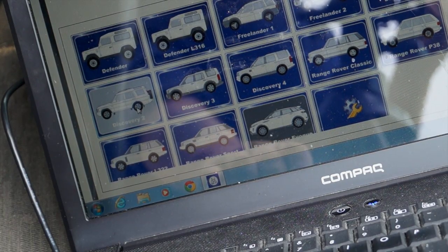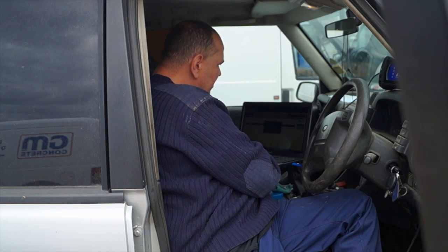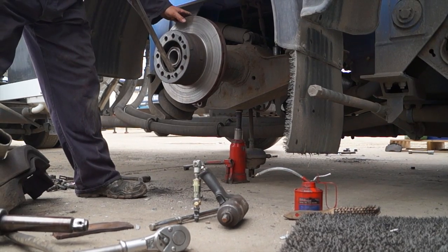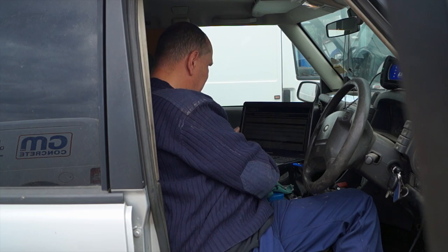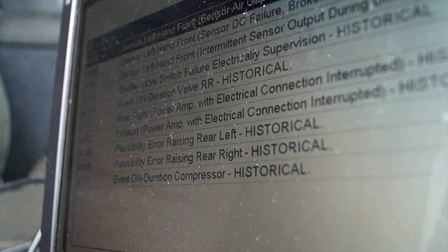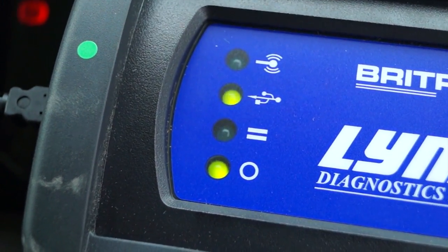Using a laptop with an interface device means you actually have more facilities available. I'm no stranger to ABS faults - part of my job as a Heavy Goods Vehicle Technician is to rectify ABS and EBS, which is Electronic Braking System, faults. Standard practice is to go in, see what codes you have, wipe them, and then get on and see if you can regenerate the codes to find the actual faults.